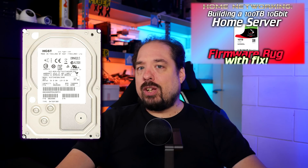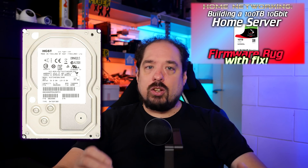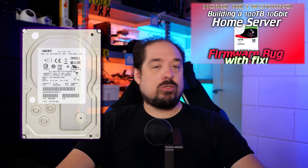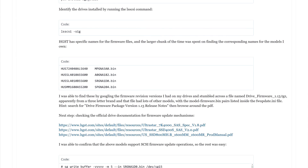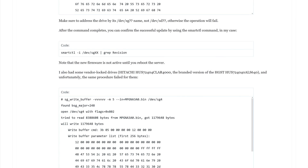Back to those new 3TB disks — those are HGST UltraStar 7K4000 disks. I've used those in enterprise storage systems before, and after needing a firmware update for my Seagate IronWolf 10TB disks, I looked into firmware updates for these drives too. I stumbled across a very helpful topic on the ServeTheHome forum, and using SGTools, which are kind of generic SCSI SAS tooling, I was able to flash all the drives with the most recent firmware. Instead of explaining exactly how to do that in this video, I'll have the post linked in the description, but if you have any questions, leave them down in the comments.